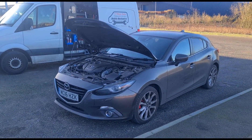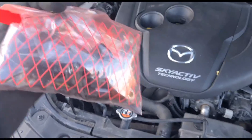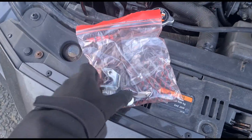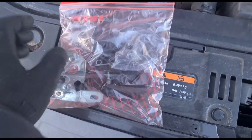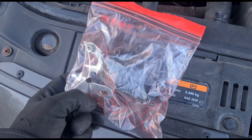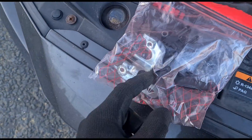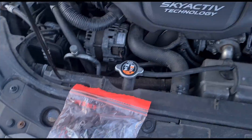Hello, it's Timmy here at Ourlies. I've got here a Mazda to look at — it's got a DPF problem. The customer has just arrived with a bag of parts that have been changed: looks like a DPF pressure sensor and a couple of other sensors — a MAP sensor and an exhaust pressure sensor by the looks of it.